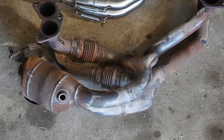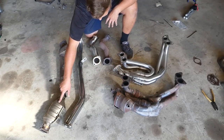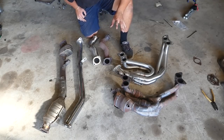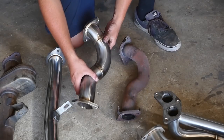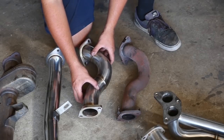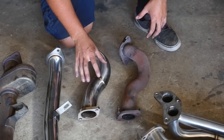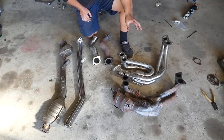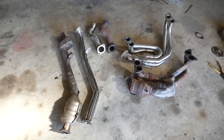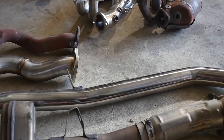I've got all the old exhaust out — these are the factory headers. I've taken the heat shield off to show you what you're actually dealing with. That's a catalytic converter, and that's also a catalytic converter — we've pulled both cats out of the system now. Contrasting the overpipes: it's about a two inch overpipe versus the Sydney Motorsports Engineering which is two and a half inch stainless steel. The factory pipe has dents all through it — these are factory dents, not damage — pretty restrictive. Fingers crossed this picks up a lot of power with the two and a half inch overpipe. I've gone with an equal length header. From all the research I've done, they pick up a lot more mid-range torque and higher RPM power. Because we're going for more power, I don't care for the boxer rumble in this vehicle — I'm only going for power — so I went with equal length headers.